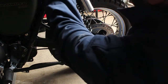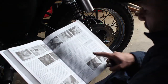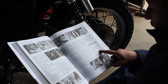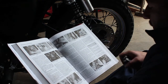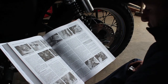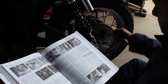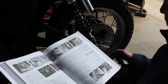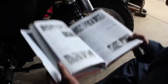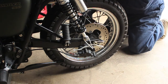So that's the brake caliper. Now let's remove the axle nut which is on the other side, and remove the washer. Turn the chain adjusters in to provide some slack on the chain. Support the wheel then withdraw the axle and lower the wheel. So again: remove the axle nut, tap it in, this will come out - support the wheel again. So let's do that. This is coming out pretty easily.